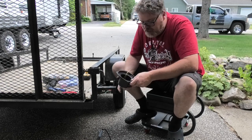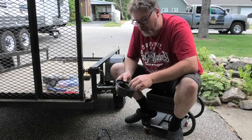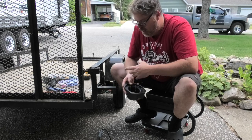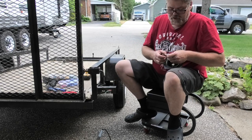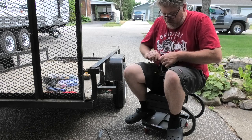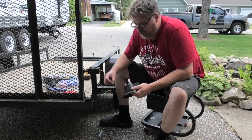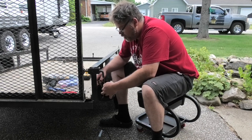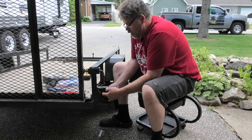Alright, I figured it out. The black is for the side marker light, the white is for the marker light in the back, and the yellow is the signal. So yellow goes to green and white goes to orange — that's the way she goes. We'll twist these two together and these two together, put a washer in here, and put this back into the trailer.